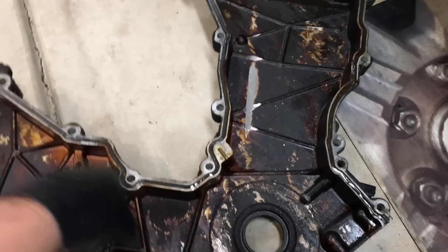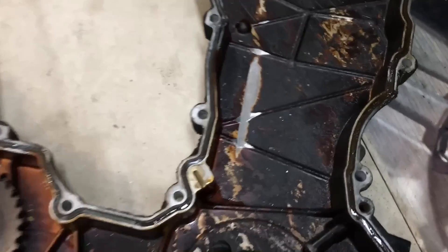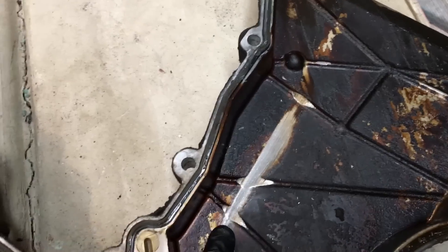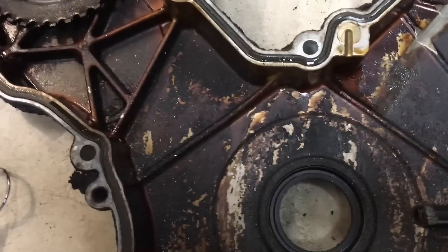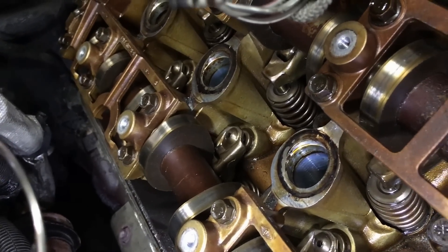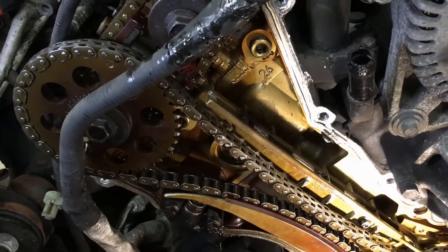This is upside down — passenger side right here. You can see the driver side is protected by the tone ring and looks like new except for varnish. But here, where the chain broke up top, this is smooth — no rough edges. All this metal has just worn away over time and dropped down into the pan. This is why you don't want to let it happen. This engine might be junk now. The top end actually looks pretty decent — journals look good, cam lobes look good — so we're going to go ahead and fix this and see what happens.